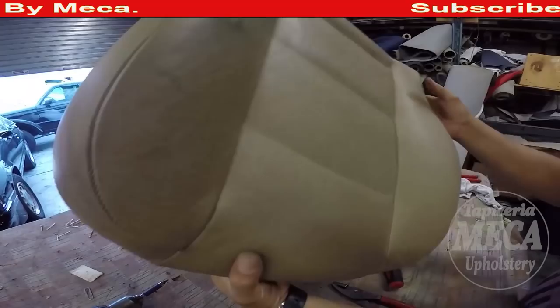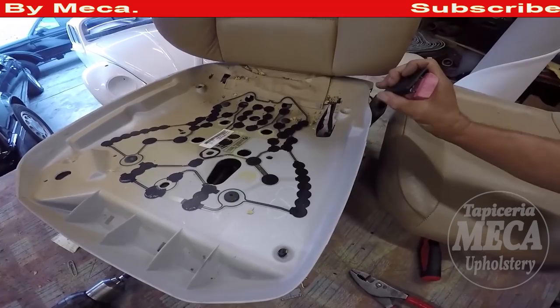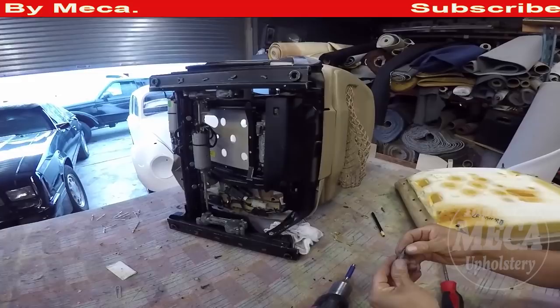So I got this bottom cushion already. As you can see right there, that is a sensor. Just be careful. That is an airbag sensor. When the passenger sits in there, in case of an accident, the airbag will explode. But if nobody is sitting, in case of an accident, the airbag is not going to explode. So it is a sensor. Just be careful with that part. Don't scratch it, don't cut it. And it is not necessary to cut it. As you can see how it is.